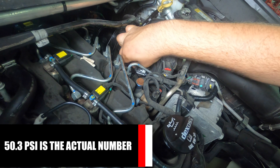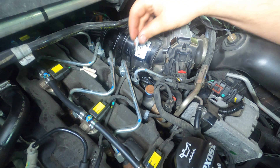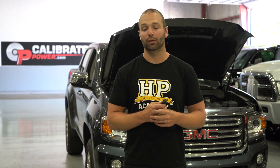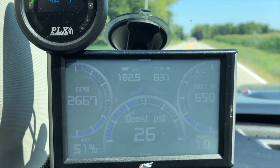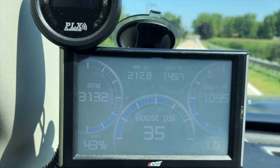As long as you go into the ECU and rescale the sensor, the ECU can now see boost all the way up to 45, 46, close to 50 pounds depending on resolution — we'll call it high 40s. It's a cheap upgrade: the sensor, the pigtail, and using AllData you can rearrange the wires so the ECU gets the signals it needs. Once done, your digital dash, Edge, Banks, or whatever PID reading device you're using will read up to that high-40s boost number, giving you great turbo control on a larger turbocharger for the 2.8 liter platform.